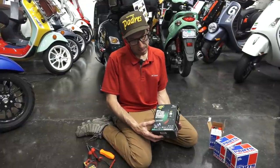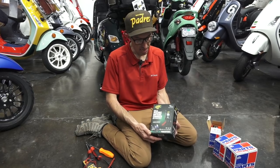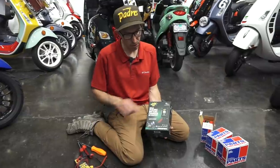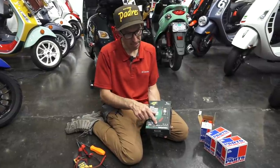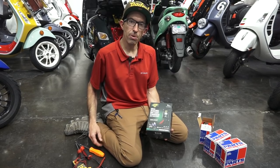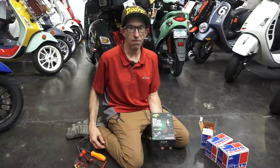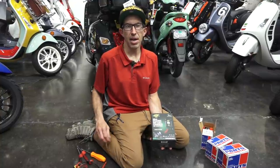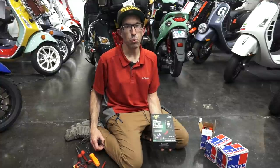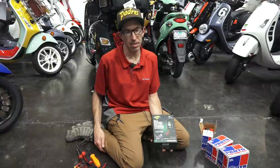Make sure you get one that's lithium compatible. If you buy the latest Battery Tender Junior 800 we sell at ScooterWest.com, there's a little push button that changes the voltage between lead acid technology and lithium. You can use older chargers as long as they don't have the high voltage desulfate mode, which would be found on that much larger Optimate charger — those modes will damage a lithium battery, could possibly overheat it and cause it to swell.